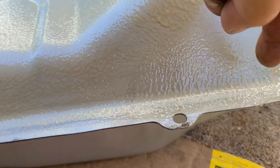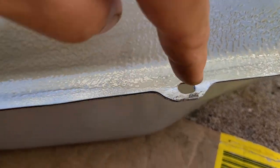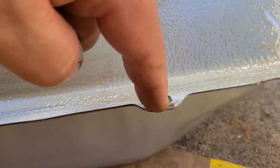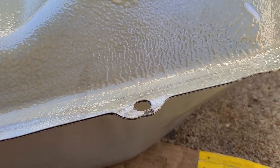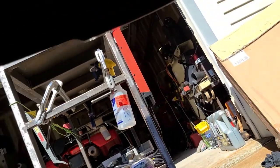When they drop the tank throwing it in those cardboard boxes - whether it's a UPS guy or whoever - they bent this all down. Take a pair of pliers and straighten this up - that little ridge right there where they weld it. These were all bent and folded from being in the box. You take a pair of pliers and go ahead and fix them, but the situation is you want to cover them with fluid film so they don't rust out. I also noticed there's a little ding right here - that's not cut through, but obviously something hit that. We'll just dab that with fluid film - it'll creep right in there. It's not a hole, but I would send it back if it was.